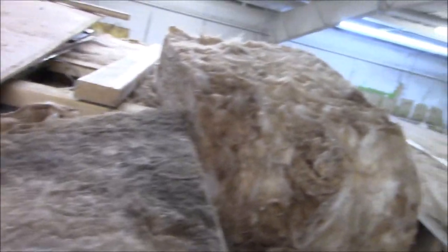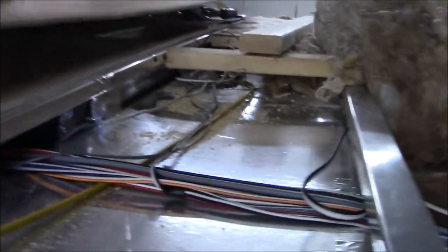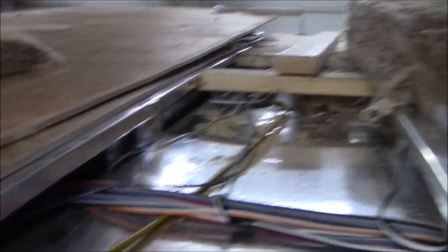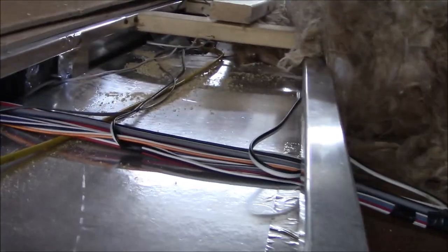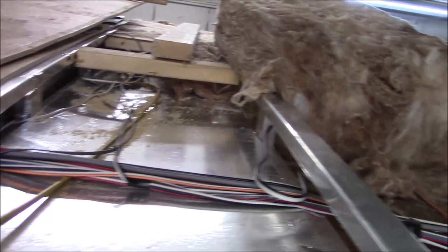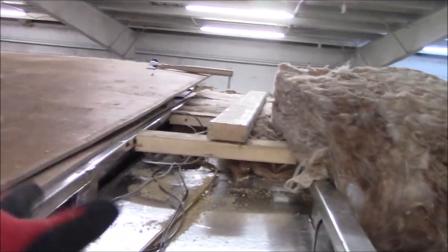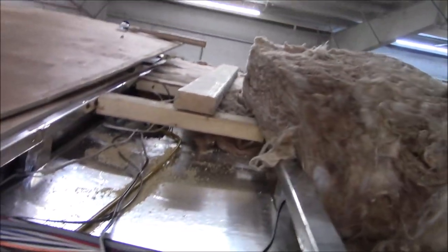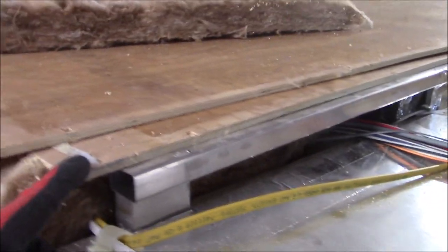The way they did this air conditioner, they had a truss going right through the center here — this is all they got. They're bridging it with this. The problem is because they've got this air conditioning duct here. Something needs to be done to bring that back, so we may have to make a new truss — one for this side and that side. That's not going to be enough to hold that, I don't think. It was bouncing pretty good when we were walking on it. This is just three-eighths, and this is a high dollar coach.